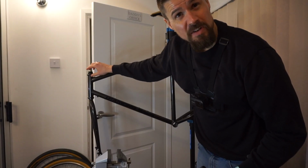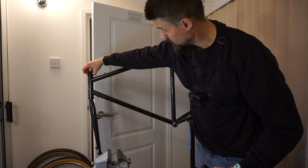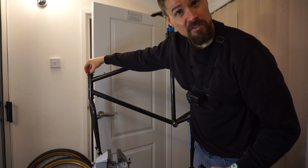So without further ado, here's the footage of me getting the headset sorted. There's just a little bit of an issue with the headset in that once I've tightened it down fully, there's still play in it. And I've tried to install a headset spacer, but it's a 1 1/8 headset spacer, and the problem with that is that it moves left to right.